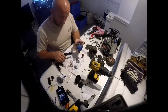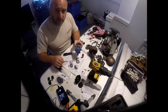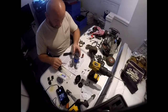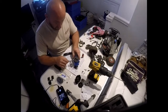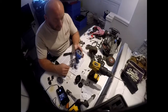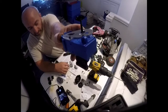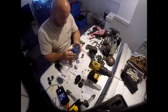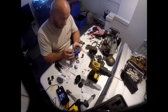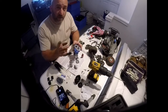Still building the gearbox. A bit I'm struggling on — I'm following the instructions. The bottom one here says M3 by 10mm button head. So following the picture, M3 by 10, measure the button head up — perfect size. Does not go in any further than that. Poked something in there, there is definitely something stopping it. So I think that might have to be a shorter button head in that position. Let me know how you get on please.